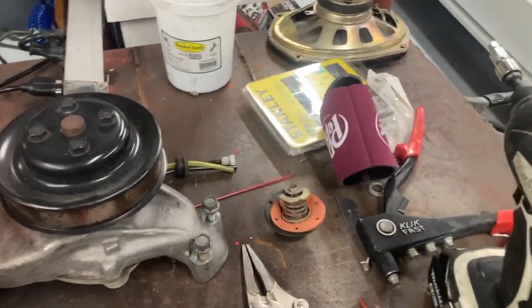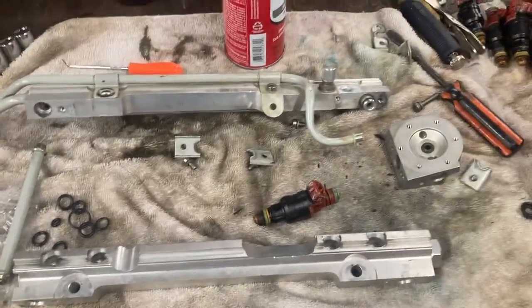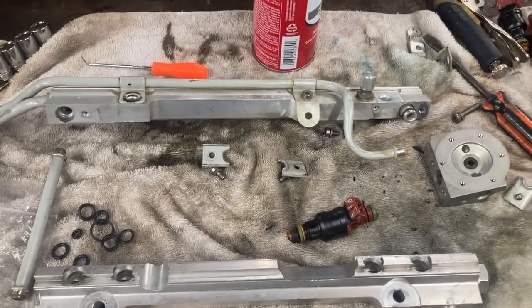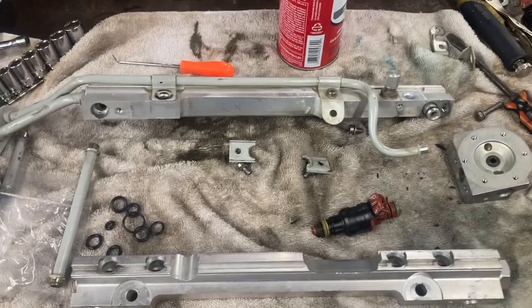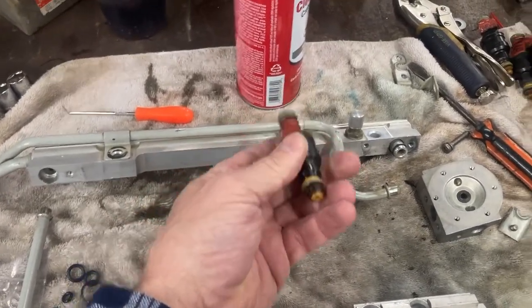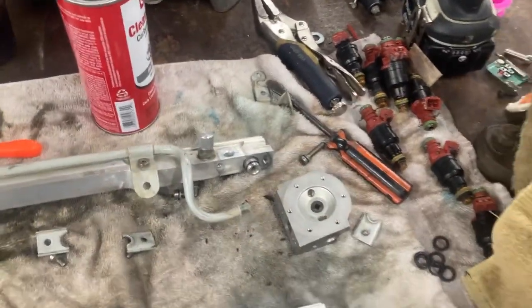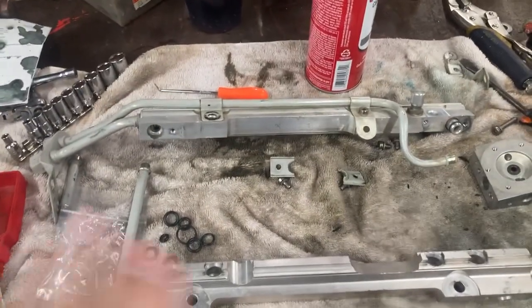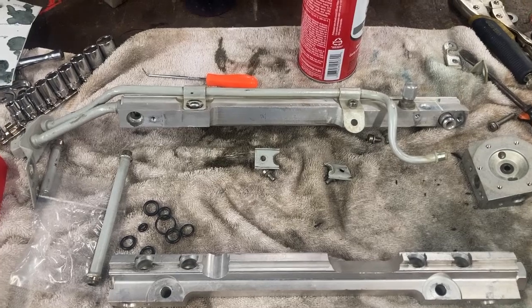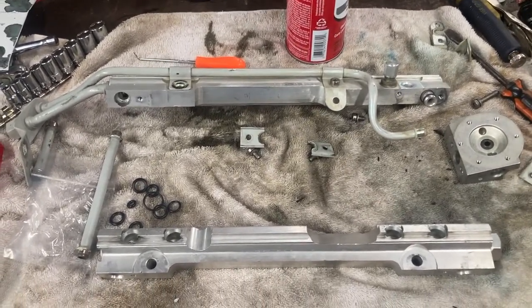On this setup we lower the base pressure down to about 32 to underutilize the injectors when the car is at low load, and then under boost it goes up into the 50s, so it makes it spray a lot harder. But that's a hot rod application. On a stock application, all your TPI cars are going to have 24-pound injectors.